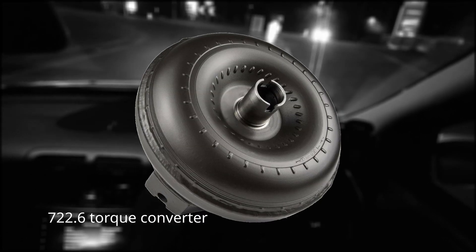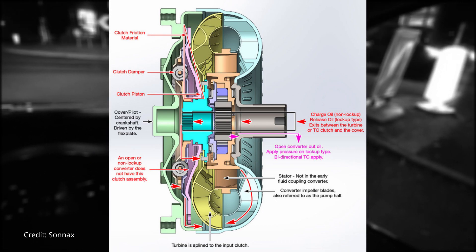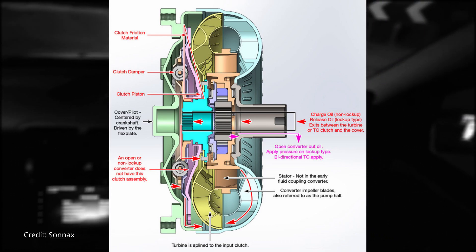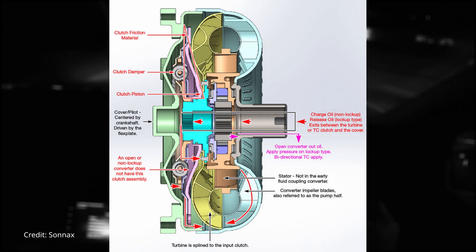The first thing to do was to enable the torque converter lock up, as this will drastically increase the fuel economy of the vehicle. When the converter is locked up, the engine now has a direct connection to the input shaft of the gearbox, rather than it having to spin the turbine of the torque converter using only fluid, which is great for torque but horrible for fuel economy.